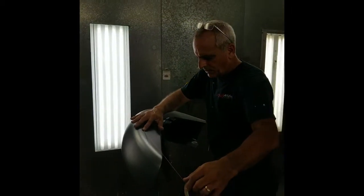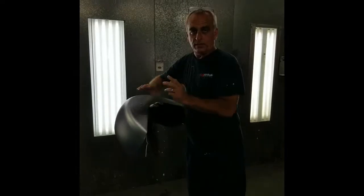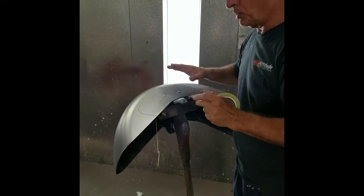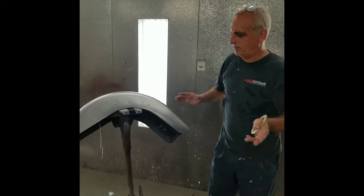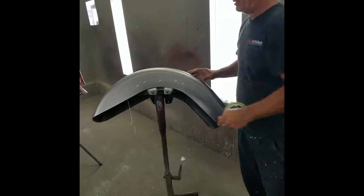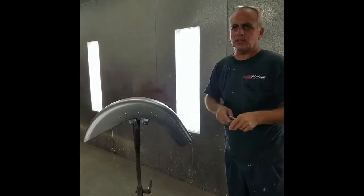Just go around — in this particular layout it curves back. This is the top stripe; I'll do the other side. One thing you don't want to do is make this corner too tight, because the next stripe is going to be eighth-inch and that's a little tougher to turn. You want to leave yourself a nice smooth loose curve. As you can see this is pretty much a perfect layout — probably better than what Harley does. I'll do the same on the other side, stand up and compare the two sides, then show you the next step once I get all the 1/16-inch stripes laid.